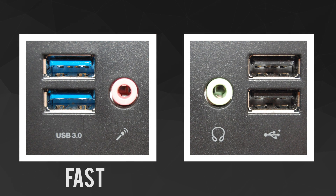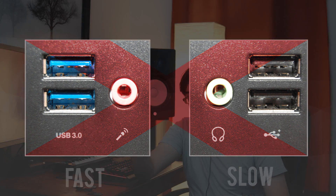And number three — which is what most people know — is the I/O. A lot of people just see USB 3 or USB 2 and think it's either fast or slow. That's not true at all. This is one of the biggest misconceptions in the consumer and IT world. The connector does not determine speed. USB 3 and USB 2 are just specs that tell you the maximum theoretical bandwidth — like lanes on a highway. Just because you have one car or a hundred cars on that highway doesn't mean you're fully saturating what that spec can do.